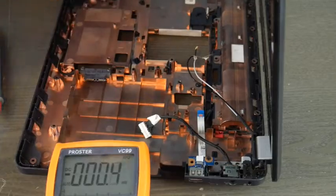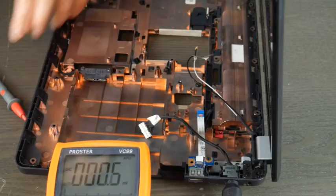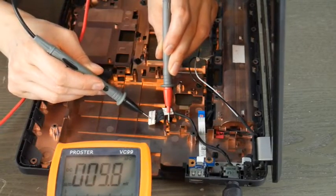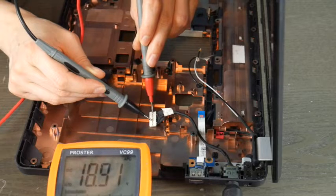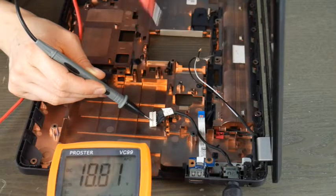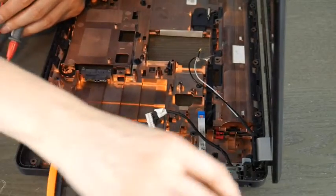I'm going to go ahead and plug it in, and do red prong to red wire. Now that I've pulled back the tape, I'll put the black one with the black wires. This will give me a readout as to how much power I'm getting. In this case, I have a working power jack — 18.9 volts, well within the realm of acceptable for this computer. If you aren't sure what your computer needs, you can look underneath and see the suggested voltage rating. From one egghead to another, this is Liz signing out.